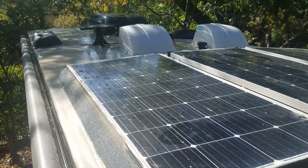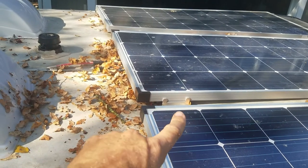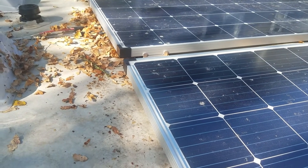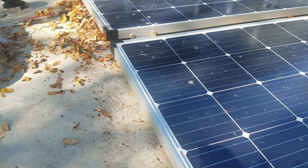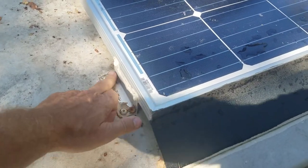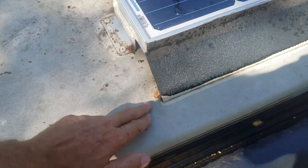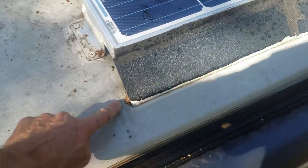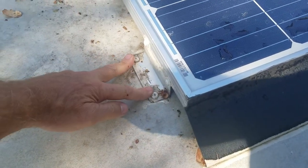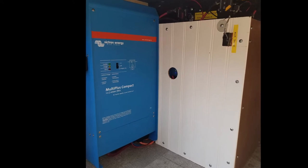Let me show you the back, because there is a trick to mounting these solar panels, at least on a 19 RLE. The normal place to put your brackets is on the side, but they don't go into any decent support underneath. In the back you can't remove the ceiling from inside the trailer to add additional support. But what I found is there's a seam in the plywood right here with solid structure underneath where you could put some additional brackets. Sorry, I didn't film any of the actual installation, but I'll do a detailed review of what it looks like completed.